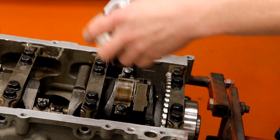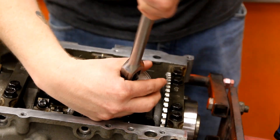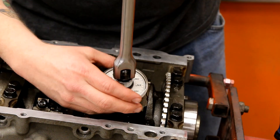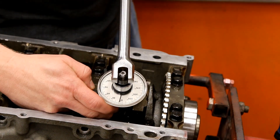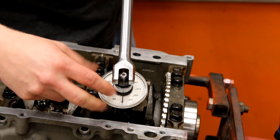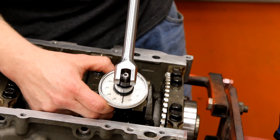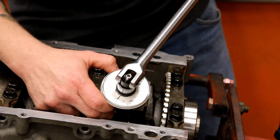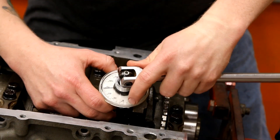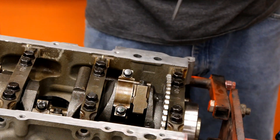Now it's zeroed, and then we're going to take this up to 80 degrees. Then we're going to come back around and do the same thing on the other side — this one will lock up against the crank. You want to make sure you hold the gauge tight against whatever you're locking the rod against, otherwise it can move around and cause bad readings. 80 degrees.